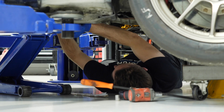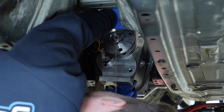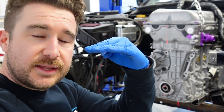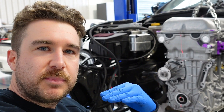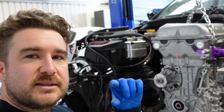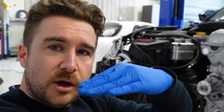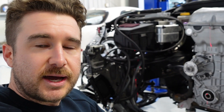We haven't got the gearbox exactly lined up yet but we're using the laser line as a reference as we cut away the tunnel. One of the more critical things to get right is the angle between the diff head and the output of the gearbox. They don't need to be in a perfectly straight line, but the universal joints at each end of the tail shaft need to be at equal angles to avoid vibrations. That's why getting the engine incline in the right direction and aligned down the centerline of the car is pretty critical.